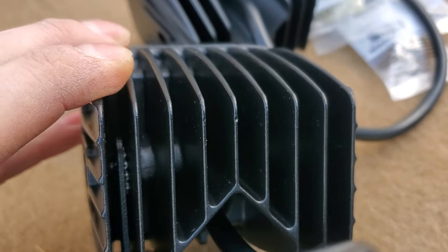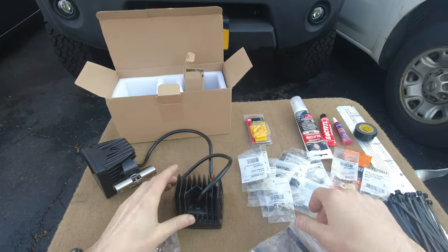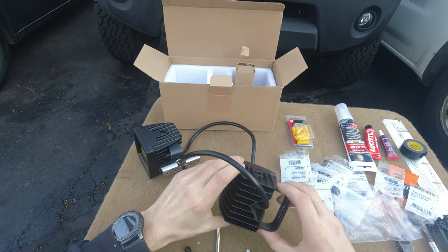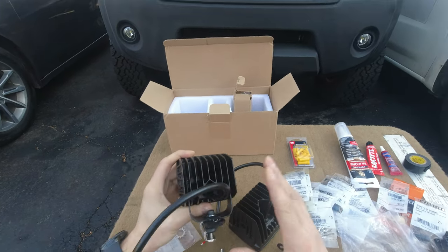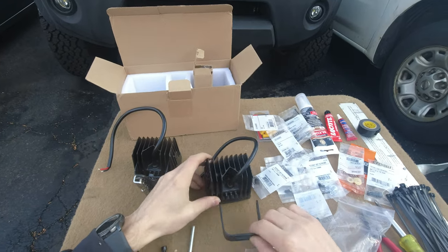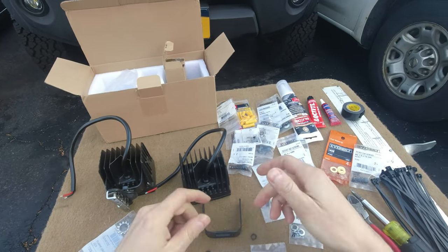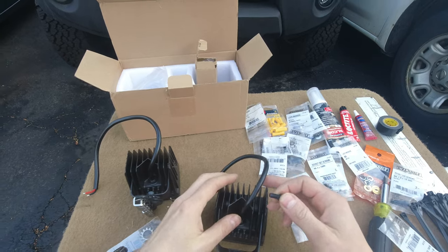With a spring washer, it all came out good. So now I'm just gonna repeat the procedure with this light and we're gonna be ready to install it. This is the hardware that comes for this particular light. One of the things with this bracket is it doesn't really get tight in there, so that's why you need to use washers on the inside — then it gets tight. First on the inside we're gonna use these 3/8-inch lock washers. We're gonna use these 14mm screws that go on the sides, along with two spring washers that it actually comes with. To align all of that in there can be a little bit tricky, but just play with it, take your time, and it's all doable.